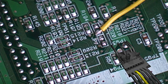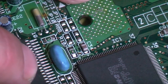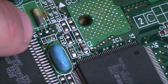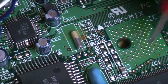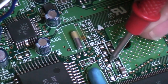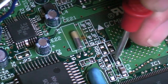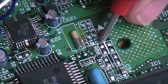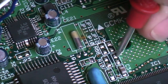That's all we need to do on the bottom of the board, so next we flip it over and attach to that side. Looking at the top of our Model 1 motherboard, right where the CD-ROM gets screwed down is where we find the rest of our jumpers. There's a little chart showing jumper 13, 12, 11, and 10. Again there are no zero-ohm resistors - instead there's a tiny wire link joining the pads. The very two far-left ones are ground and the far-right ones are 5 volts. We need to sever these two and put a link joining the others.